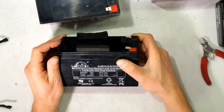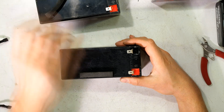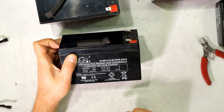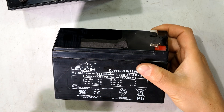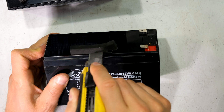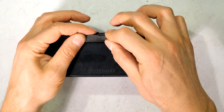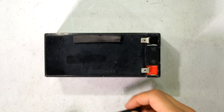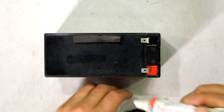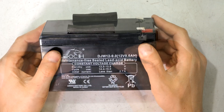These sponges need to be transferred to the new battery. Remove them by lifting off — one and two. Mine is tearing a bit but as long as most comes off it's fine. You can also take a blade and slice it off, then stick it onto the new battery. Here is my replacement battery — one sponge was fine to stick down, the other I had to slice off. I'm going to use a little double-sided tape or cold glue, just two or three dabs, to attach the sponge. In my case I'm using thin double-sided tape.